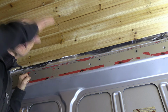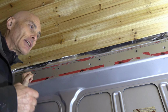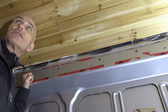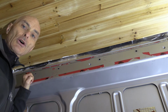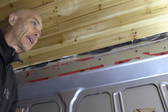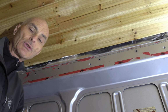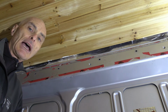Anyways, the rest of the ceiling went well, which tells me that after the brush got saturated with varnish, whatever happened kind of disappeared, because the rest of the ceiling looks fine. It's about the first third or so. So this morning I'm going to sand these boards, at least the areas that are affected. There's a number. And then reapply varnish. Yesterday I got some lacquer thinner, so I was able to clean the brush properly. And I'll use it again this morning and see what happens.